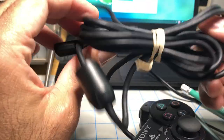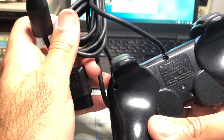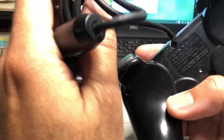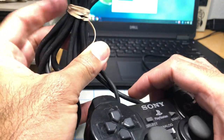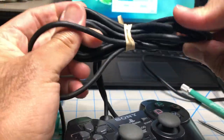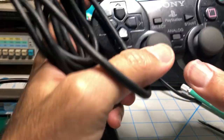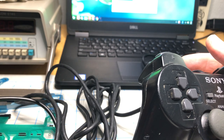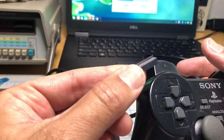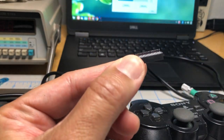Most of the H controllers, the core is always fine. The A model, on the other hand, once we get into them you'll see a lot of them have problems — frayed wires is a big deal on that model, but not on the H. The H core is never a problem, always in good condition. It's a better quality controller overall, despite the big flaw — but it can be fixed. And not only do you fix it when you replace the connector, you make it so it could be fixable in the future, because now you can unplug the ribbon cable and just put in any one.